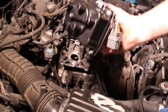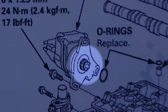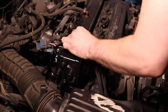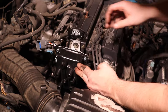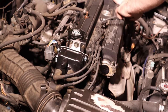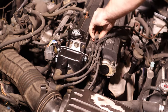Here's our new distributor. When installing it, the ends are tapered so you can't install it into the camshaft 180 degrees out of phase. You're going to get it locked in and put the bolts in finger tight because we'll need to twist the distributor a little when setting timing. I also decided to replace the spark plugs since I haven't done that in about seven years — let's get a full tune-up in.